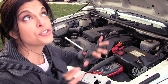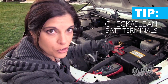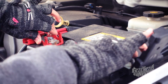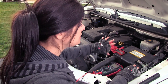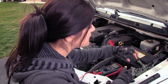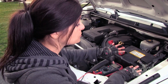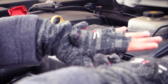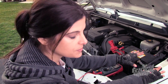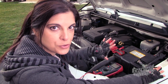Number one: the majority of charging system issues actually come from dirty or corroded terminals. Check that they're not loose — they should be on nice and tight. Where the ring clamps onto the post, make sure there are no gaps and it clamps on evenly. Also look at the corrosion; on my negative terminal you can see some green beginning to build up. I left that on there on purpose to see if it has any effect on our final two tests, but this is something you want to take care of.